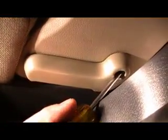And we've been living with it like that for a while. We don't really use it that often, but I do need it. Anyway, the way you get this apart is there's a screw right here in the handle, Phillips head screwdriver, and it's very tight to get. So you need like a right angle screwdriver or something to get that screw out of there so you can get the handle off. Okay, so once it comes out, pretty easy too.